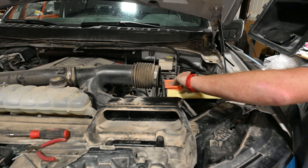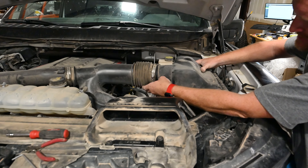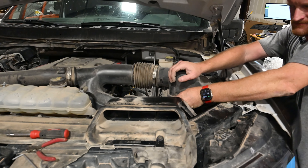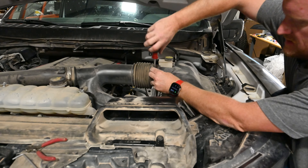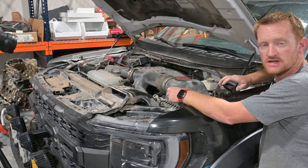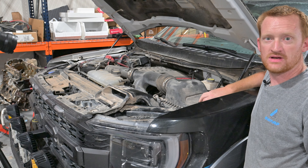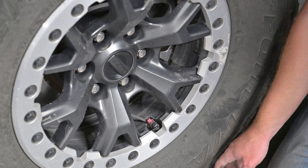Now for the fun — this thing is kind of a beast when you get it in here, but just drop it down. It'll go like this, just try to get it on the frame rail. Now it's sitting in position, we just need to put those two bolts — 13mm heads — through the clip nuts we just put in there. Just drop the bolts in there. There's the compressor on it, bolts in, 13mm head. That's how it should look — except yours will probably be black unless they start making more orange ones.